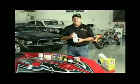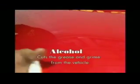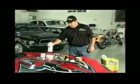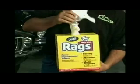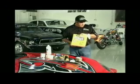A couple of things that we have here, we have the isopropyl alcohol, and this is to clean the vehicle. That way it cuts most of the grime and the grease, and it is great to use on your third stage of cleaning. We also, with that, use some lint-free towels. These are pretty good towels to use. We use that to wipe off in any of the stages that we have. We use that to wipe off the alcohol.